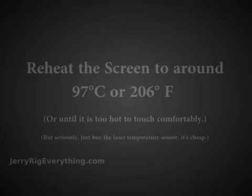I'm going to put this screen up every time I reheat the phone, just to remind you what temperature it needs to be at. You can see that the glass shards on this phone will come away individually. They're not laminated like they were on the Galaxy S4. I kind of liked that about the S4.